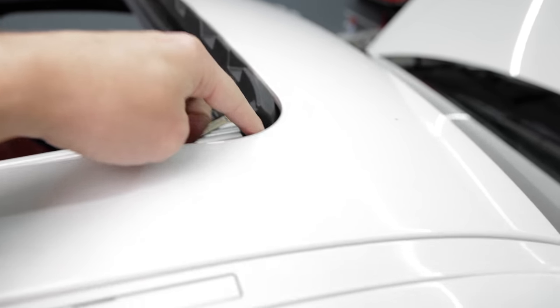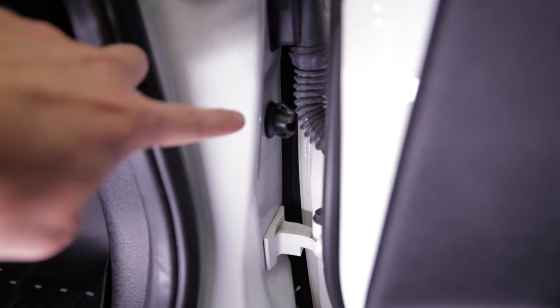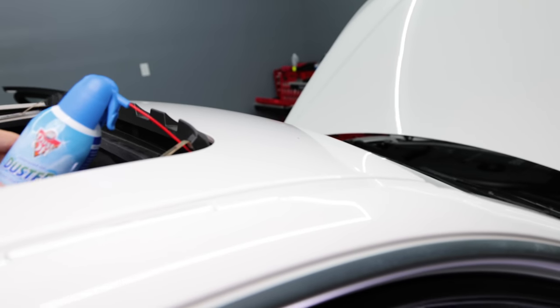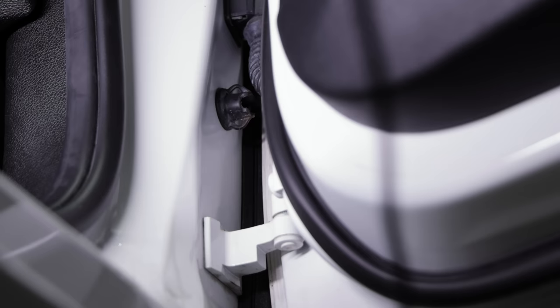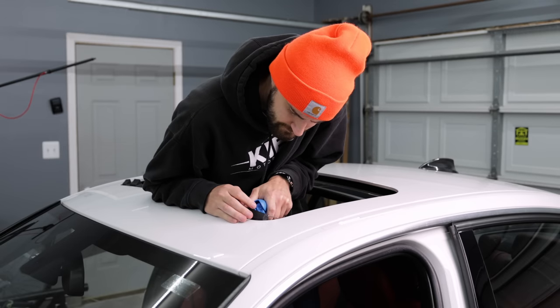There's basically a drain hole on each side that goes down through your A-pillar and out a little hole in the door jamb. I always just use a can of compressed air — put the hose inside the drain and see if anything comes out. I already messed around with this last night, so I wasn't expecting a huge amount to come out on camera, but we got some crumbs and dirt that came out — you can see some on the ground as well. If your drains are really clogged you can even use string trimmer line to physically push stuff out.